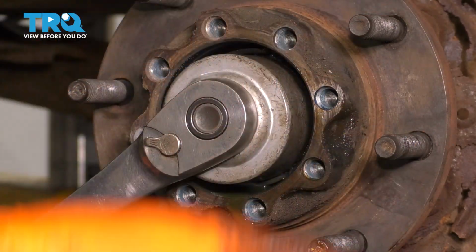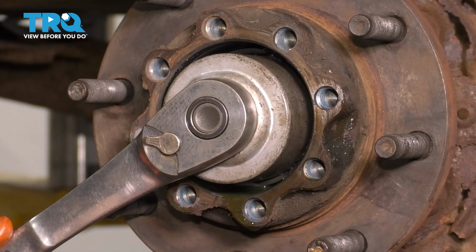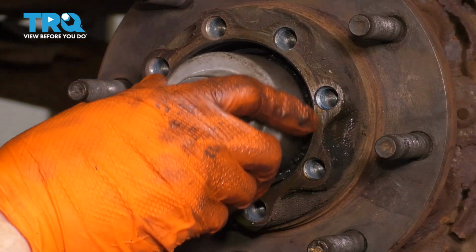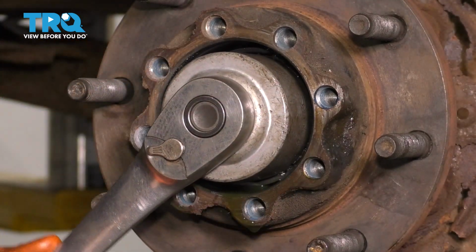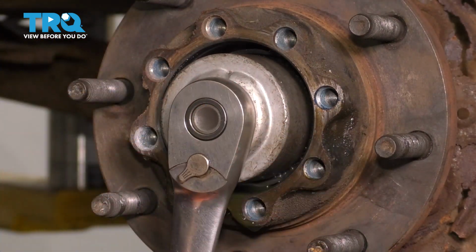And that is because most of the time the wheel is going to spin forward, and Ford designed it so that as the vehicle's moving, it is obviously less likely for that ring to spin by itself and loosen up. You would not want that to happen. So it's reverse threaded. It's going to make ratcheting noises the whole way around. Just remove it.